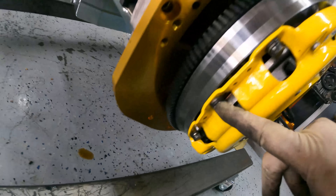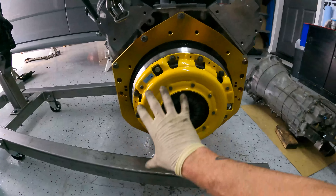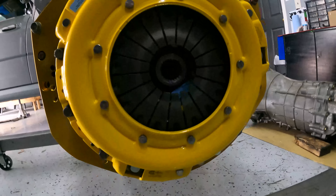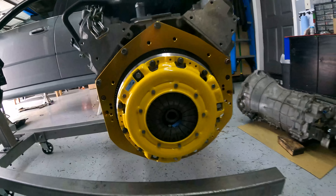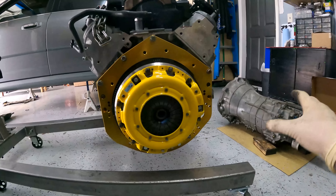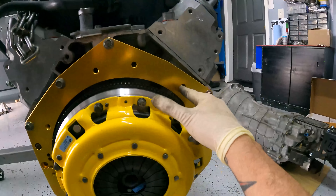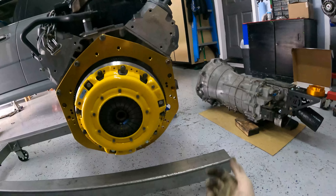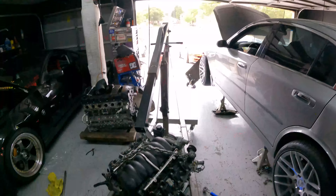Now walking around — verify, make sure it is touching everywhere. I know it's done. I can pull this out and if you look straight in you can see it's a direct shot all the way in there, so that's going to be ready for the input shaft. Now it's time to mate this to the transmission. I'm going to spin this around, use the transmission to kind of pull up to it, and use those bolts to bolt it here, here, here, and here. We'll use the starter bolts to hold it into the trans, and there are also two down here we'll use as well. Let's put the transmission on first.